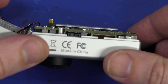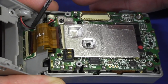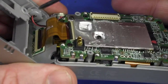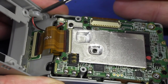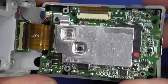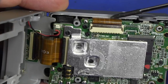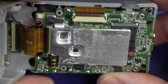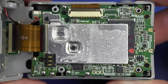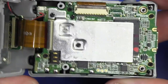There's one main board — standard 1.6mm thickness. It looks like we've got a secondary board down there for the expansion header. We've got some flat flex going over to a flat flex connector. We've got the microphone insert up there going over on wires — I'm not sure why they decided to do that rather than integrate it onto the PCB and have it stick through holes in the top of the case. And it looks like we've got another flat flex going over here, possibly to the LCD or the sensor. There might be another board under this one as well, but it's quite densely packaged in there.